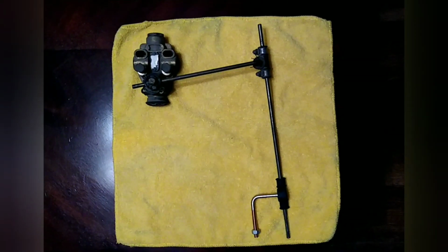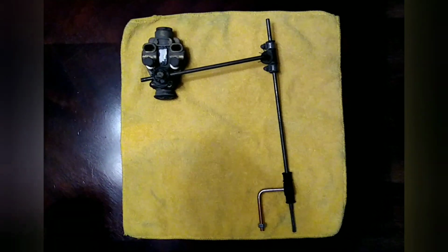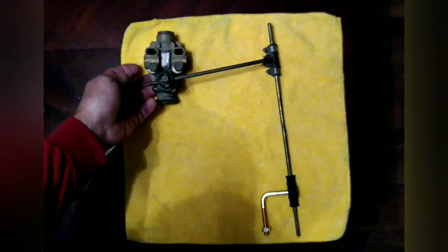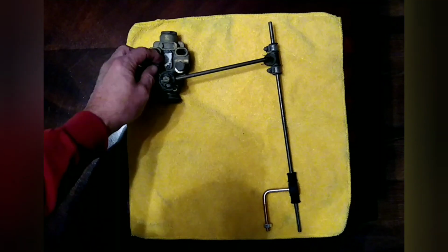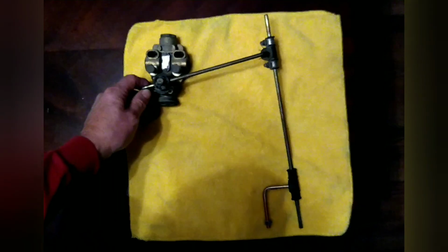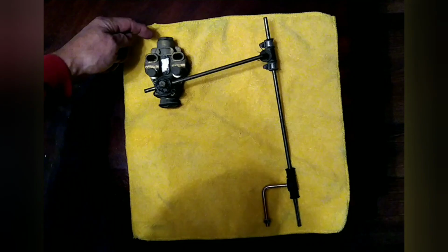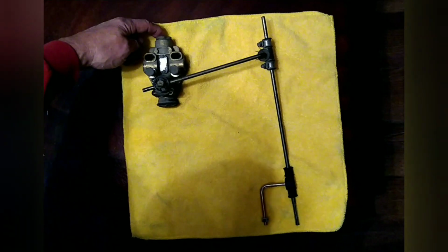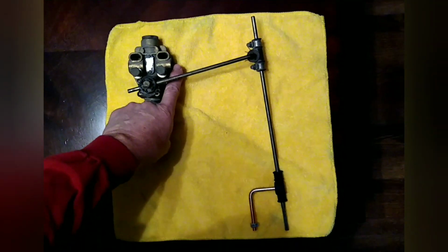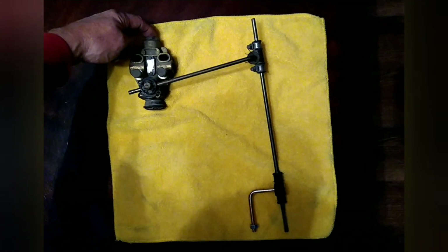This is how the valve is set up on the coach. This is the original valve. We've already taken it off. And I'll show you here, these two 3/8 bolts, the 9/16 wrench, they are nutted on the back side of the plate to remove them. Your air lines, since this was the left-hand side valve, we had the line coming in here, going to the airbag. The line at the top is the air supply line, and this line was blocked off. So if you were on the opposite side of the coach, it'd just be reversed. This would be to the bag. This one's always your top supply line.